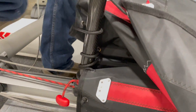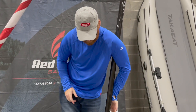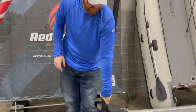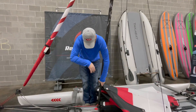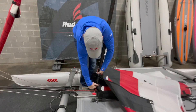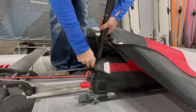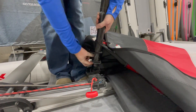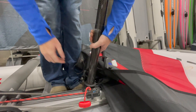So how I grab the mast in order to unhook this is I like to grab it with my armpit — get my arm around it. It's worth noting that you can just pick up; you don't have to do anything special. The forestay and the shrouds are going to hold the mast so it's not going to fall over. So you're just going to pick up with your armpit so that the mast is lifted and you're just going to unhook these. This bottom one's a little tricky, but they should come off nice and easy if you've done that little prep step.